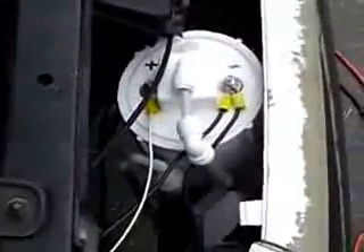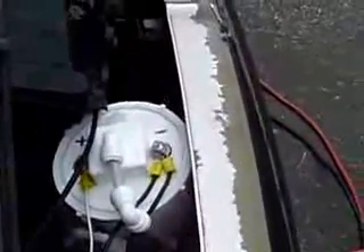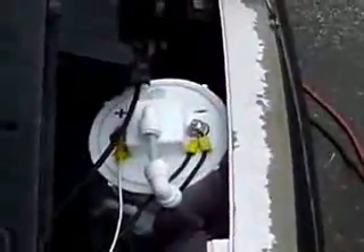This one's working a lot better than my other one. At operating temperature, the unfortunate thing is this booster in particular, since it's mounted in the back by the firewall, gets up to about 125 degrees — sometimes 130. The one up front here, the 16 stainless steel plates is covered with heat shrink. The SMACK design says it's best to cover them — you get better readings as far as lower amp draw and lower heat for longer periods of time. Unfortunately I was only able to get one piece of heat shrink, so I covered this one, and you can definitely see a difference in the two. This one runs hotter because of its location and because the heat shrink isn't on. This one runs at about 105 degrees after three hours straight, plus it's getting a hefty wind draw from my fan right there.